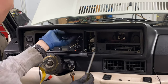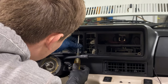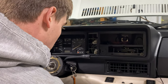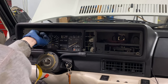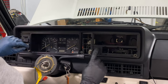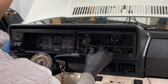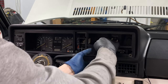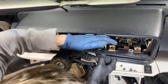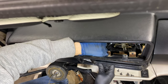Looks like we don't have a screw up here, but we do have two right here. Carefully pull this out — we still have to disconnect the connector to the fan control and we have to disconnect these two switches here. So first pull this out a little bit. Disconnecting this fan switch, simply just pull backwards and wiggle on this plug. It's on there pretty good usually.